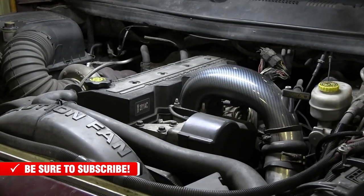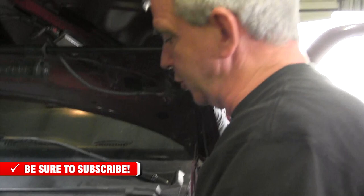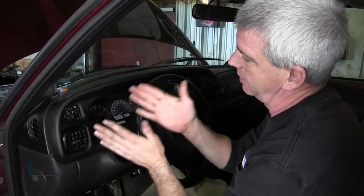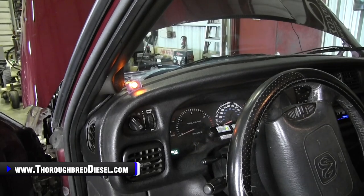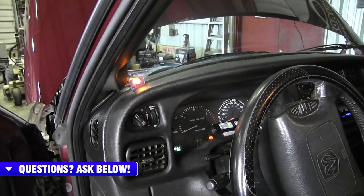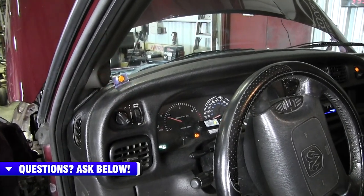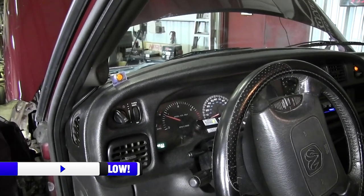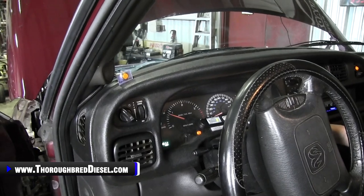So now Vince is going to go ahead and start the truck. If the truck runs and it stops, that's okay — we're going to bleed it at the injectors, but it may not. I like to try it this way first. If it's run that long, you're bled out — you're good to go, no problem. Let it sit and idle for a few minutes and you'll be good. Now we're going to show you functionality of the light. The AirDog low pressure fuel light is going to illuminate if the pressure is less than five PSI. When you turn the key on in one of these trucks, the light's going to illuminate because the lift pump's not running. But as soon as the lift pump runs, the light is going to go out — that's what you want. As soon as we get pressure, light goes out.